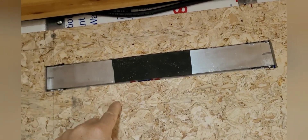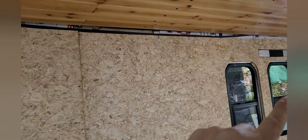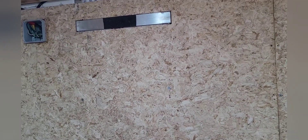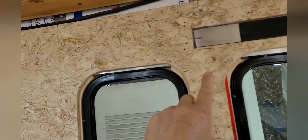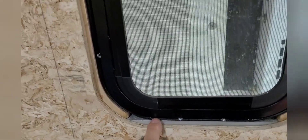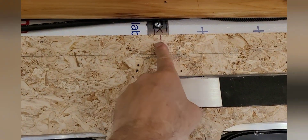This is a better option — it gives a little more strength using both rather than putting a hole in that skinny tin. This way it holds together, plus it's screwed into the board. The particle board here adds rigidity to the wall because the load is distributed throughout the trailer. These trailers rack all over the place so you have to be really careful. This one here ended up right on top of the window, which is really good. I also put brackets in the windows and welded them up — there's a bracket that goes all the way across with some maple hardwood.